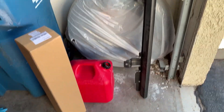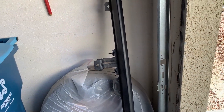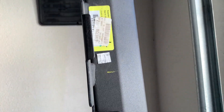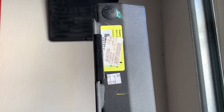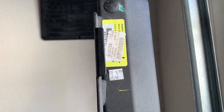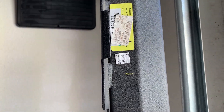Here's the rocker guard standing up to get a better look. It is the same length as the other one. We do have to be careful when installing - there is a left and a right. If you have rocker guards from a Rubicon or pick some up, there's always a sticker: one's yellow and one's blue. These identify part numbers and also tell you if it's a left side or right side - left being the driver's side, right being the passenger's side. Pay attention to this.